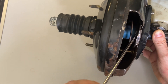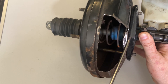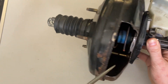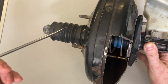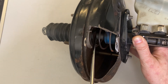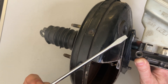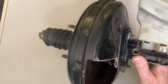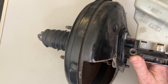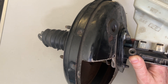Other seals can fail. There's a front seal here between the brake fluid reservoir and the master cylinder — this is all liquid or brake fluid and this is all air. If the front seal goes, then your brake fluid can get into your brake servo. That can be another failure point. If there's any failures to the proportioning valve here, atmospheric air pressure can get through into this section, which is going to make your brake pedal extremely firm. Not only that, if atmospheric pressure comes through the proportioning valve and then leaves through here and goes to your engine, suddenly your engine is getting a lot of atmospheric air put into the inlet manifold that it wasn't expecting. That's going to cause rough idles because the car is going to be running in a very lean state, or it could cause the engine to stall. So if you ever get a car that's stalled with a hard brake pedal and you turn it on and it starts momentarily and cuts out, it'll be because additional air is getting fed into the inlet manifold and the car's stalling because the fuel-air mixture is too lean.